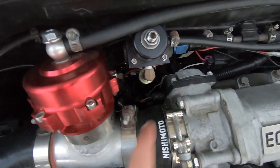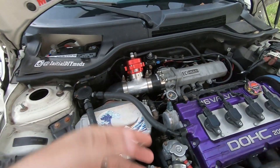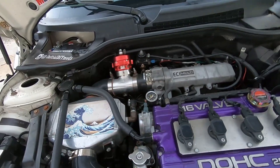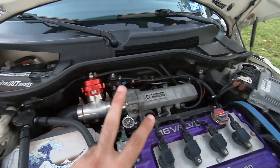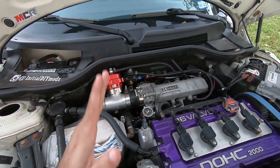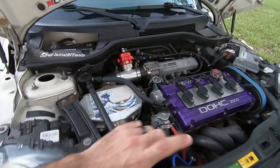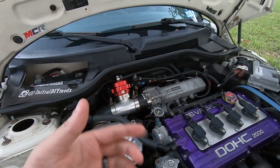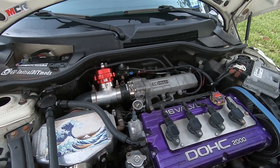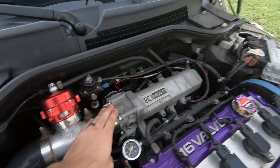There is a connector back here and that connector is a six-pin connector. It's got your motor positive and motor negative to open and also to close, as well as a couple of sensors. The sensors usually have two different styles. One of the sensors actually goes all the way from zero to 100% wide open, and then there's also another sensor that maxes out at about 80%. So if you're trying to figure out why it's not fully opening all the way, do check that because it does occasionally get screwy.